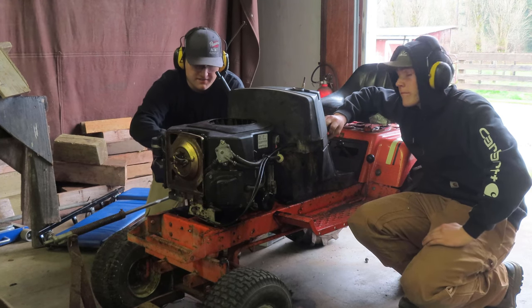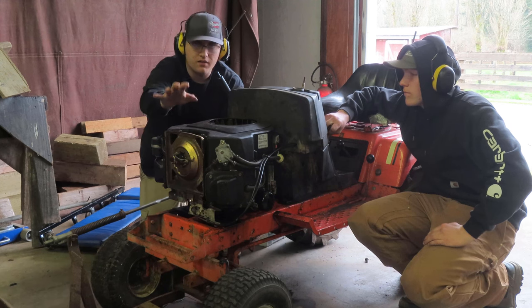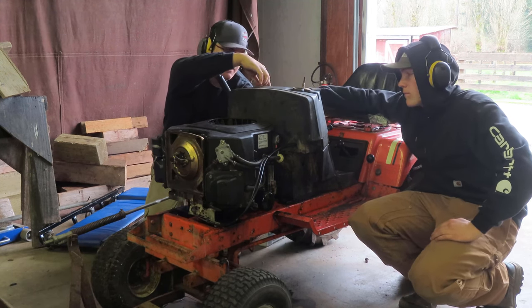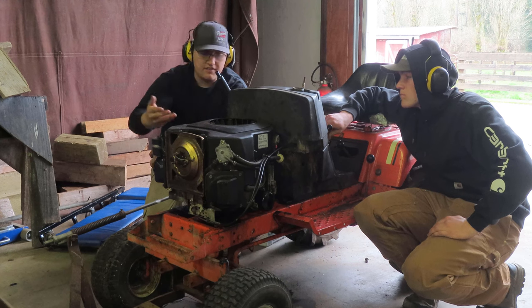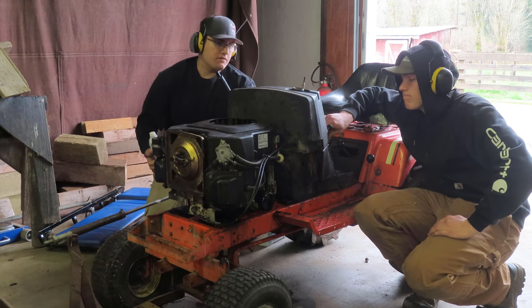Yeah, over here we've got a whole new wiring harness set up. We've got power going to the ignition block on startup. We've got a kill wire going to a kill switch that you can't see over here. Really cool looking kill switch, mind you. And we've got a couple other little doodads, such as charging to go to the lights when we wire those up. So we're just gonna fire this thing up and hope that it works.